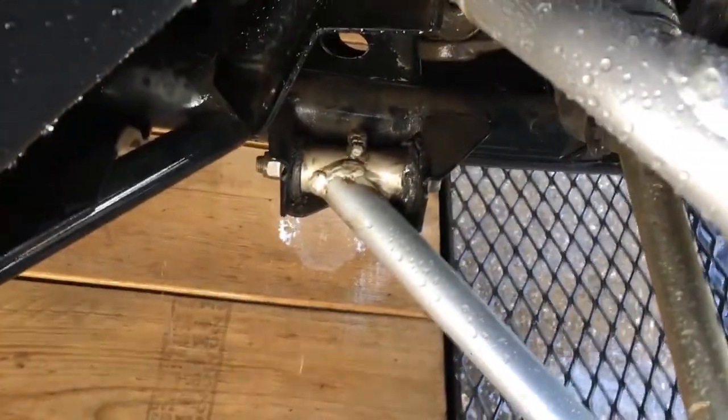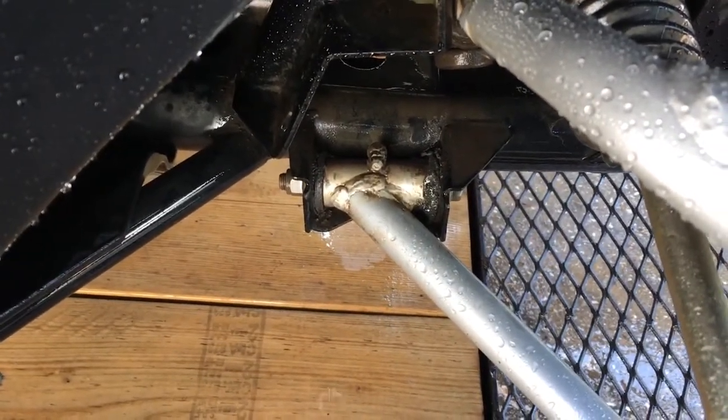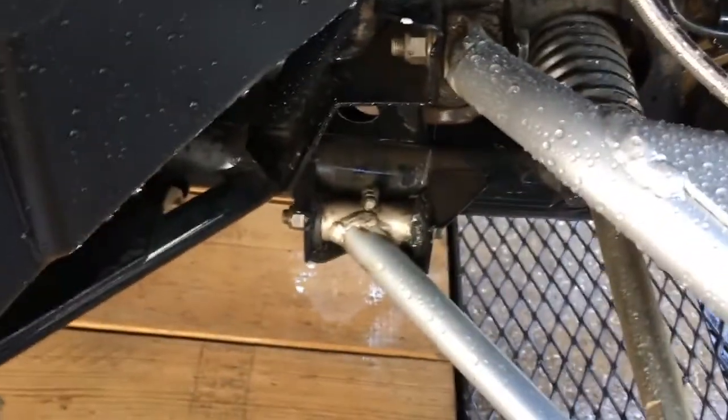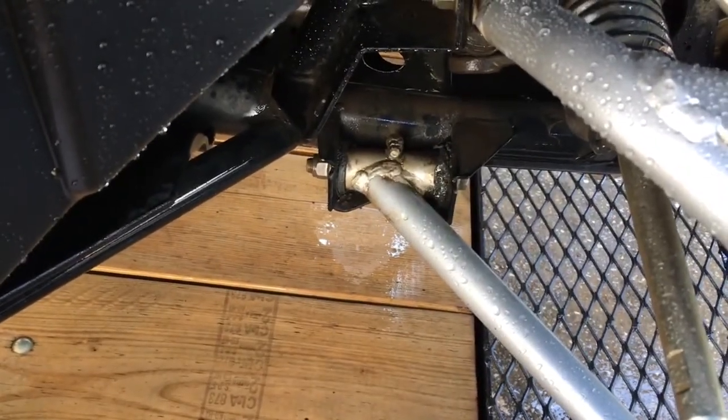One other little thing, I don't know if you can tell where my grease joints are down there, the Zerk fittings at the front suspension. You can see there's little gobs of grease coming out around the bushings and so on. I do generally grease after every ride. I haven't done this one yet. I wait until I'm finished washing. I'm not gonna get crazy and wipe out all that grease under there.